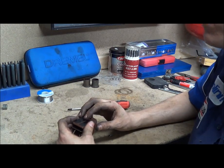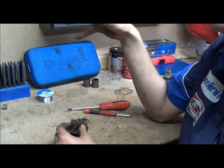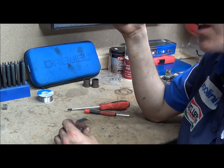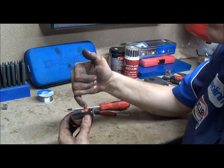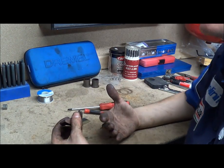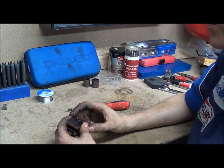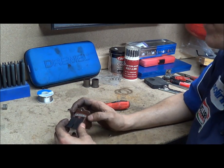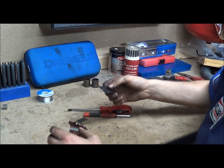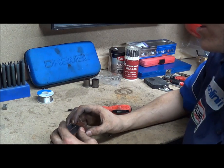It's one of those things that tuners sometimes don't play around with — different materials, but also different thicknesses. You could also do a composite staggering, where you make thinner reeds that sit on top of these to give a bit more rigidity, or stop them halfway so it changes the characteristics of how the reeds open. It's a lot of playing around. Don't just always buy off the shelf — you can buy reed material in sheet form and cut your own, try different variants, lay different ones on top of each other, get different thicknesses.